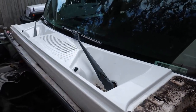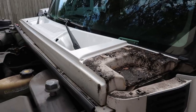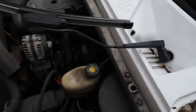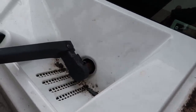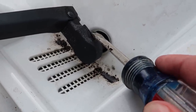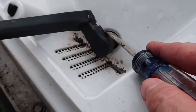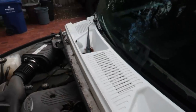Next step is to pop off the windshield wipers, and then the overall upper valance comes off, which will expose the area where the gasket should be dry rotted and the water's coming in. On the windshield wiper, flip it up so it's extended. Right down here — similar on almost all vehicles — there's a little metal spring-loaded lever. Lift that up, and while it's up, pull the wiper off the stem. Do the same on the other side.